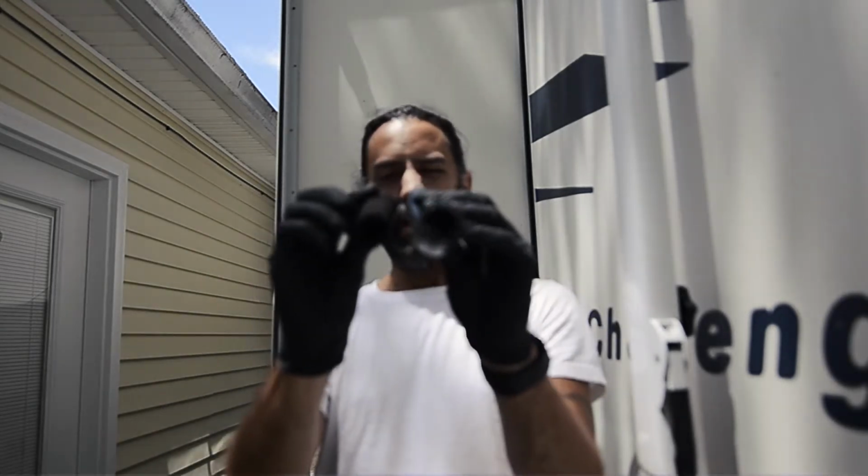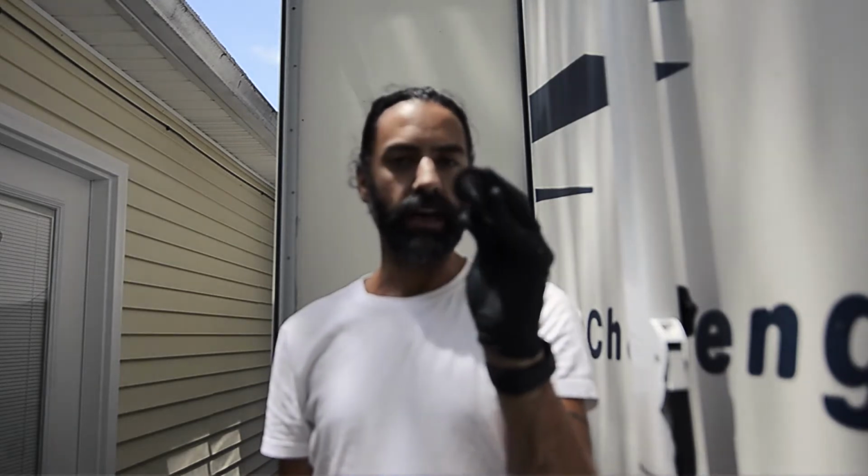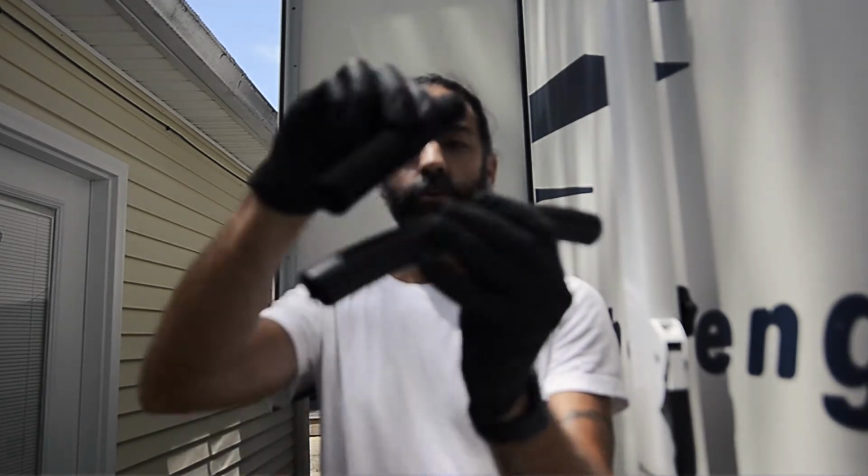So after driving around to different auto parts stores and getting no luck, a lady recommended me to a truck and trailer shop, and I walked in with this and they knew exactly what I needed. Anything that's over a half-ton truck, what they say for these vent hoses, you end up needing the bigger guys like this. The auto parts stores weren't familiar with a motorhome, so that's why I was struggling to get a part. But I just needed a new length of hose that I'm going to replace, and I'll use the same hose clamps, and that'll solve that issue.